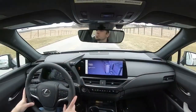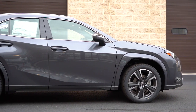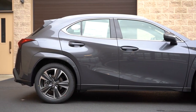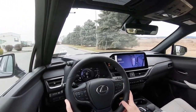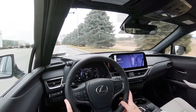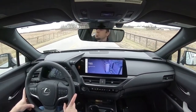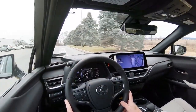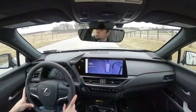Touching on suspension and handling: up front you get an independent MacPherson strut front suspension, and the same in the back — independent MacPherson strut rear suspension with gas-pressurized shock absorbers. Lexus has retuned the suspension for 2023, resulting in improved ride quality and handling. Also new for 2023 is adaptive damping suspension available on the F Sport Handling trim, which monitors each shock absorber individually, adjusting to road imperfections and tightening up during heavy cornering.